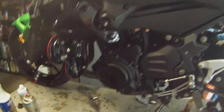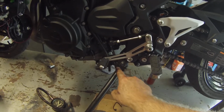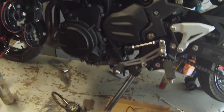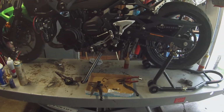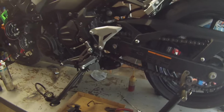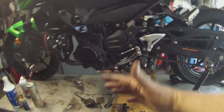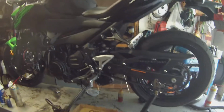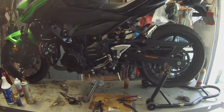So, lube your kickstand pivot. I had one of my kickstands break right there on a Venture that I had, my first Venture. The guy I bought it from had the side stand chromed, and I understand that chroming something takes the strength out of the metal. Well, I put the kickstand down and I was stepping off, and I had the bike behind me as I was stepping off, and this broke and that bike came down on the back of my legs. I didn't get trapped, but don't sit on your bike when it's on the side stand.